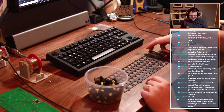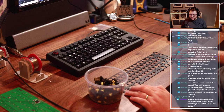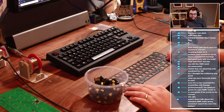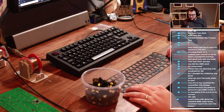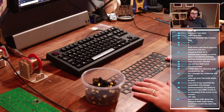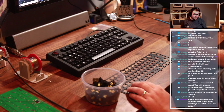You're right there, Sam. GMK screw-ins, I mean, they're really good. They're cheap. They're not that expensive either, and they're 10 times better than the fake ones that you get with most orders from like Taobao or anything off of eBay. But I mean, you can go with normal cherry stabilizers as well. Cherry stabilizers are decent. But you just got to make sure that you clip them, lube them, and I do hockey tape modding, so I will be hockey tape modding this as well, which really helps with the sound that you get from them.